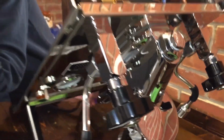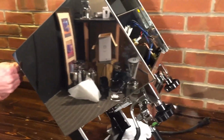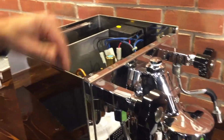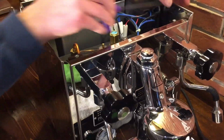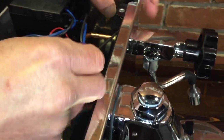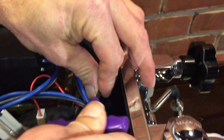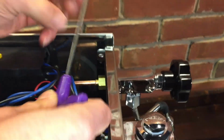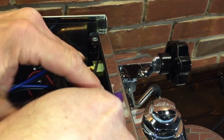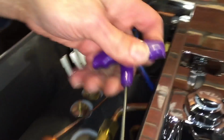Okay. So now I'm going to snug these. Don't strip them. You don't have to crank them. Just snug them up, not too hard. And then if we're happy here, we'll tighten these down, again using our 3mm one. Again, get as long an Allen wrench as you can. Yeah, they're a little challenging sometimes. If you get one that has a little ball on the end, that would be nice. I should get one of those for this. Maybe I'd save myself a lot of scraped knuckles and people watching longer videos than they have to.